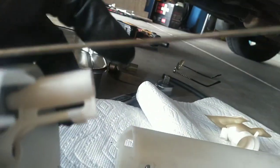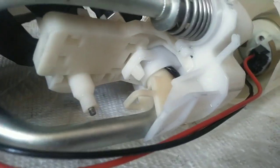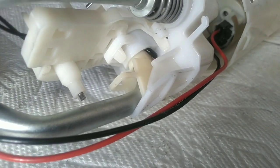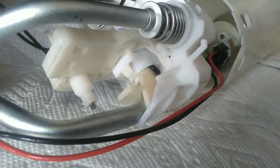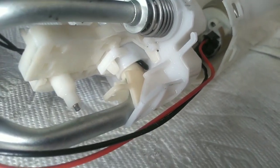The pump there — it looks like the top of that pump plugs into this hole, and that hole comes up and across to here. When I look right there, I've got a gasket coming out of there — a crimped gasket. I bet it's sucking in air there. So let me go ahead and try to reset that gasket, put this stuff back together, and get it fixed.